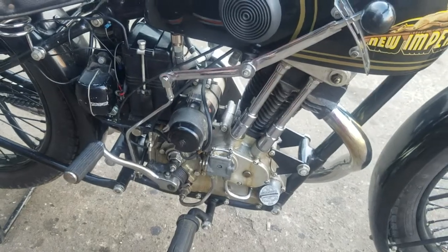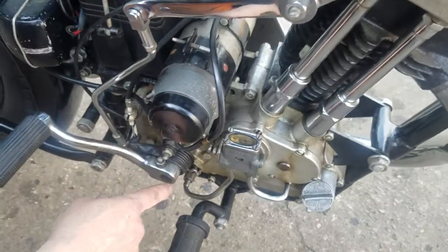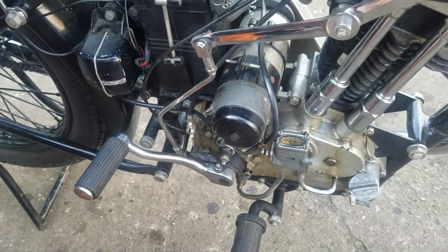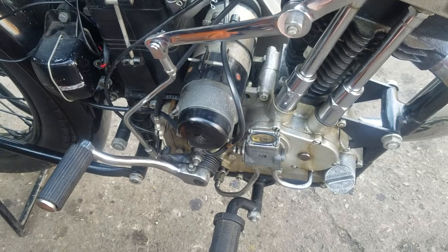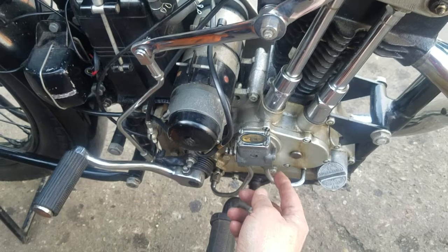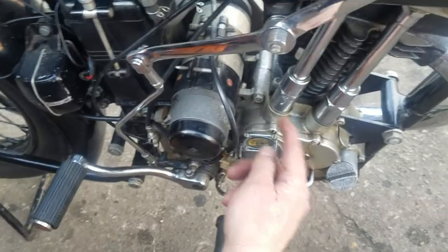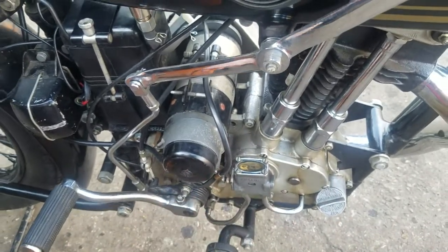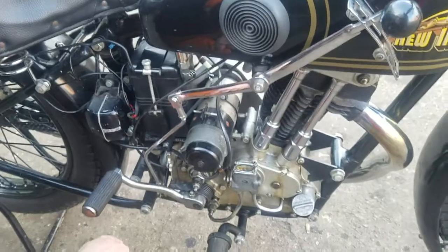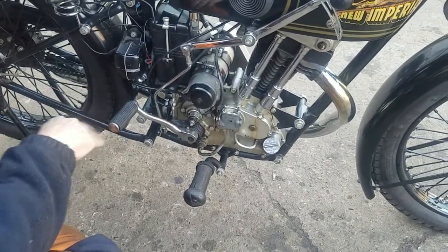So the oil system then? The oil pump here pulls the oil out from the bottom of the gearbox and puts it back into the engine, and the engine runs backwards — it's gear driven. As the oil is thrown up, I think there's a weir-type system that runs down through the gearbox. So it's one oil that does everything — engine and gearbox — and the primary's got its own little oil. Very sophisticated for pre-war.